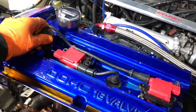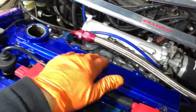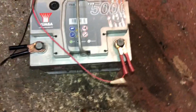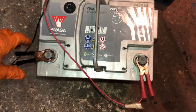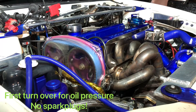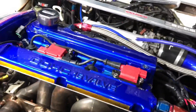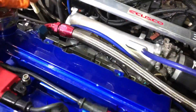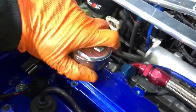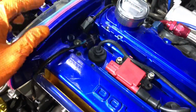I've just bunged off the oil filter housing and removed the plugs. Getting oil into the engine now to build oil pressure before starting. Unplugging the crank sensor so there's no fuelling and no injectors firing. Got one fully charged battery — had it on charge all day to ensure proper cranking amps. The battery is in the boot on this car. Final checks: plugs back in, coils wired up, vacuum lines on, fuel pump pressurised — all fuel lines sealing with no leaks. Got oil pressure up in the head now.